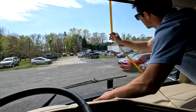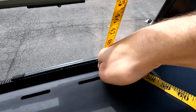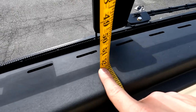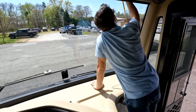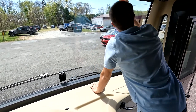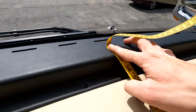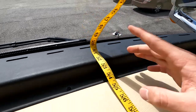Starting with the interior center vertical on the windshield, I'm going to take the measuring tape and go as far to the top edge of glass as I can, then press the bottom of the tape as far as I can reach down — coming up to about 52 and a quarter inches. For the interior passenger vertical, we're doing the same thing: going as high up to the edge of glass as possible, then reaching behind the dash where there's a little void, getting a measurement of about 53 inches.